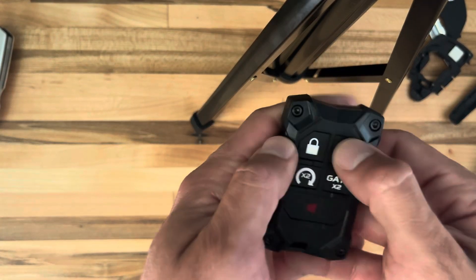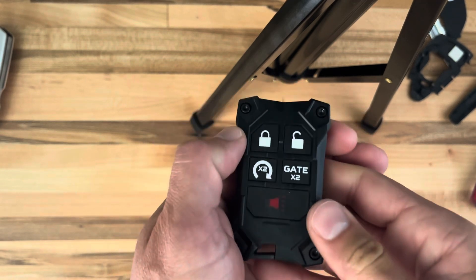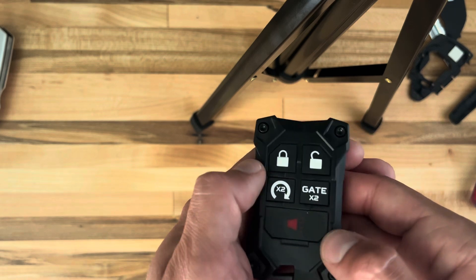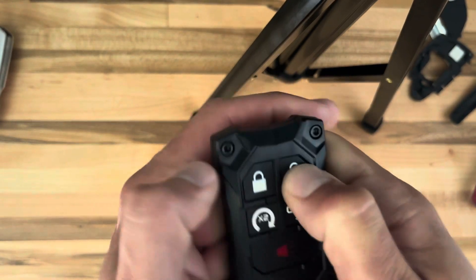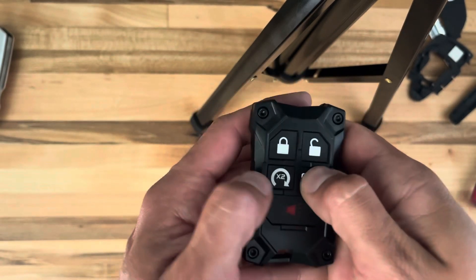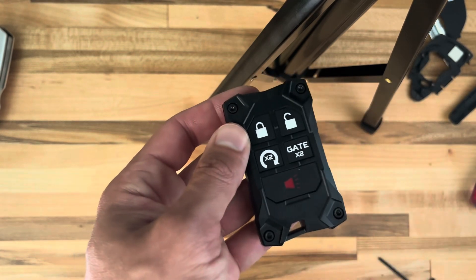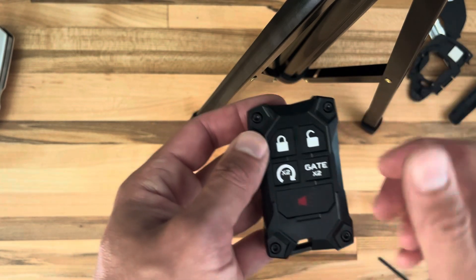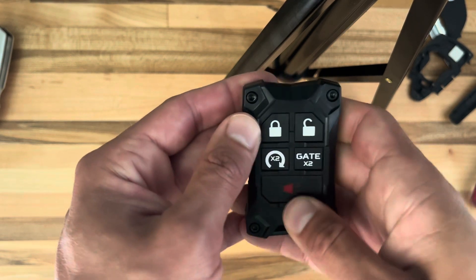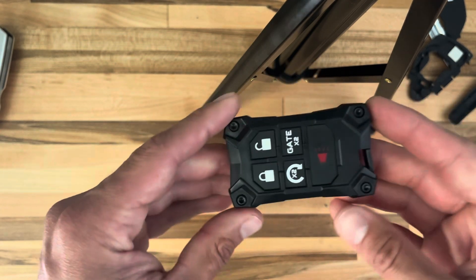Let's test all the functionality of the buttons. You will notice these buttons may be a little bit harder to press than on the factory fob — that's kind of part of the nature of the beast. When you put this thing together for the first time, there's a slight break-in period where you need to press these hard several times over and over again. You should feel a positive button feel on all the buttons. If you have any issues, I'd recommend taking it apart, removing the battery so your truck isn't going nuts, and going through these for a few minutes. Once it's broken in a little bit — which will get better over time — everything should be good.